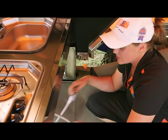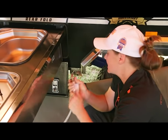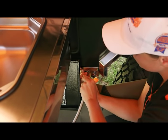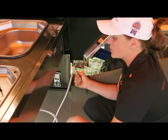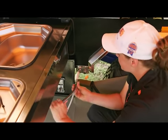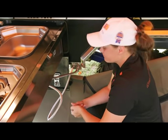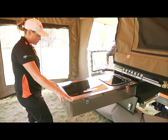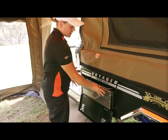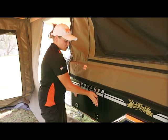Your gas is already plumbed into the actual trailer and you will have had gas certification for that as well. All you need to do when you set up your kitchen is literally just pop this in — it's a quick connect, so pop that in, give it a little bit of a push and a turn and that's going to stay connected. Make sure your gas is turned on and everything's ready to go. The other one you need to connect up is your water — same thing, it is a quick connect, so just pop it in, it'll clip in and stay there. Make sure your pump's on and you'll have water through to your kitchen. When putting the kitchen away, pull that out, push it in — the runners are going to latch in — pop that there and close her up. Make sure you lock those when you're traveling.